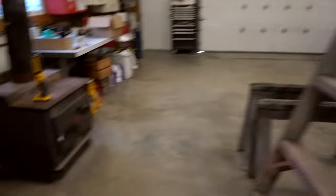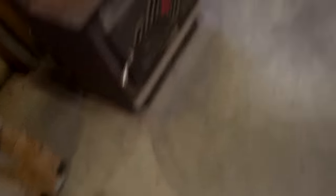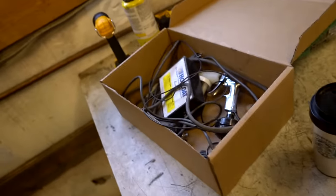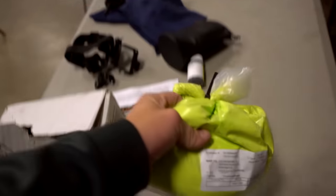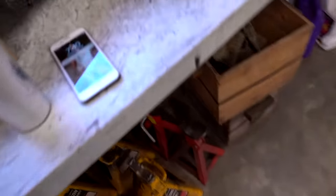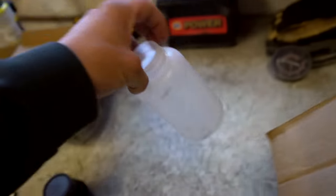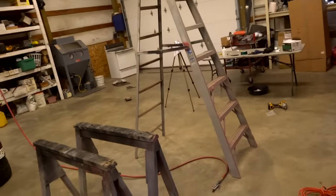While those calipers are baking in the oven we need to get everything set up for powder coating. We're going to need compressed air, an extension cord, and all of the powder coating supplies. The gun I use is the Eastwood Hot Coat powder coat gun - I'll try and link everything in the description below, including the color. This color is going to be so beautiful - straight up gloss when we get it on. You're also going to want an air pressure regulator with a filter for that air supply, a little hopper to put the powder in, and I like to use a spoon to fill the hopper.